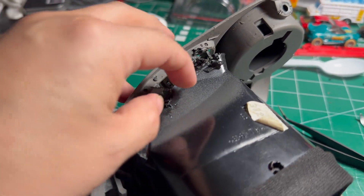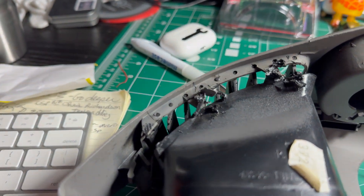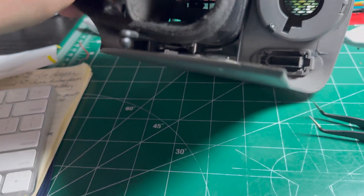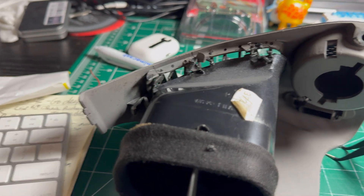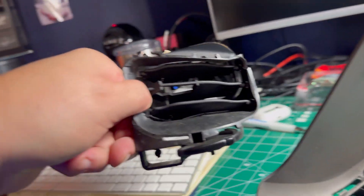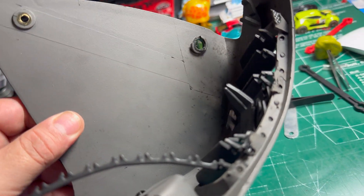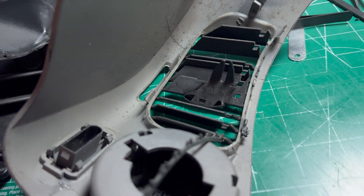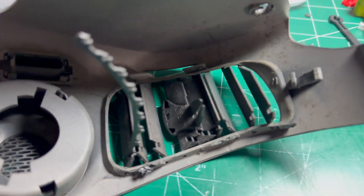It's not pretty but I got it separated. I'm just going to weld more plastic on there and use some staples to put it all back together — it should be okay. Now that I've separated it, it's not that big of a deal. I'm going to clean it a little bit too. These Porsche cars at the time were not all that great when it came to construction quality. So I've got to snap all these vanes back in to make it work again.